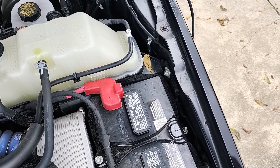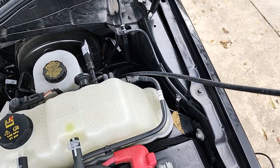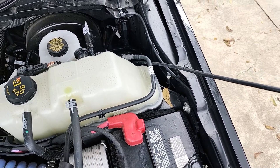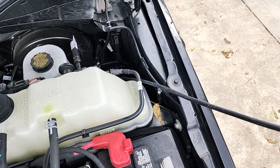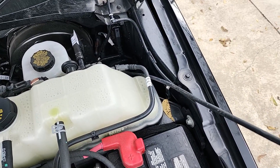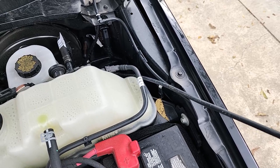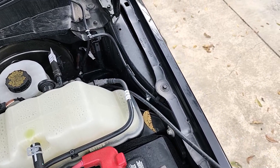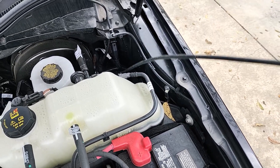Got the wire loom on the wire and now it's time to pull it up into the truck. I've got it routed down on the driver's side. Talking to John Romer, he ran his around the driver's side over to the passenger side. But on these diesel trucks, the exhaust system runs down the frame, so I think it's smart to run it on the driver's side to stay completely away from any extra heat from that exhaust system. I need to get under the truck and tape the wiring to my pull wire so I can pull it through.